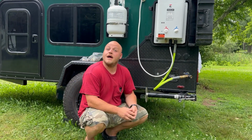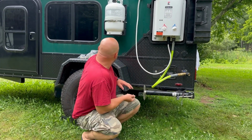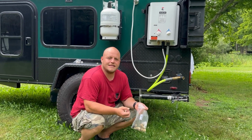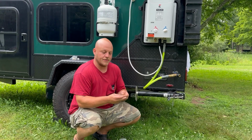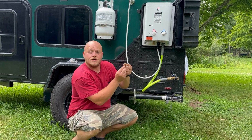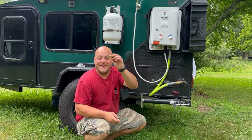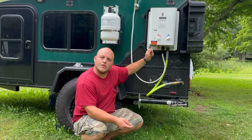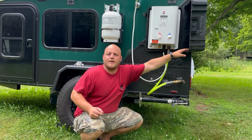We're going to have to mess around with this a little bit to be able to work with these quick connects. I'm going to list in the video description a multi-kit of the 3/8 gas fittings. That'll come in handy. But this is the issue that I ran into. If I use the adapter from the factory to go from the 3/8-inch flare to a 3/8-inch thread, and then I have to put the male on there, it sticks down too far and the box had trouble closing. It did fit, but I just didn't like how it was rubbing on the bottom of the box.